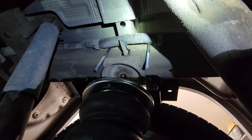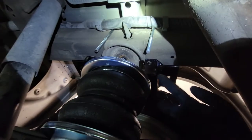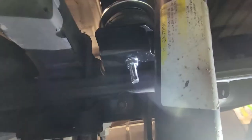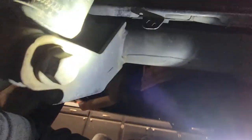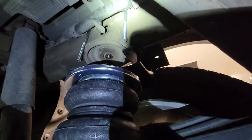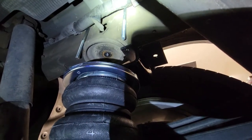I'm just waiting in place. Just thought maybe you could see. They're almost, you know, lined up pretty close. I did get the Torx back in. I don't know if you can see it. I have the two in. I didn't get the one by the wheel, so 2 out of 3 ain't bad. We're gonna go with that. But yeah, so now we're gonna jack the truck up, get those jack stands out and set it under its own weight, and we'll get those hooked up.